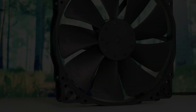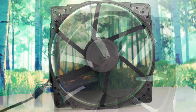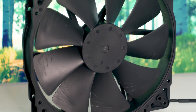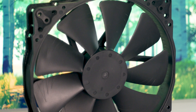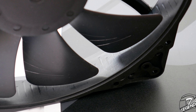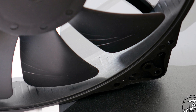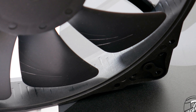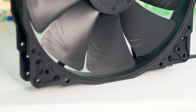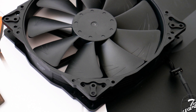So what's the point of this fan in the end? It's simple — this fan will spin slower and deliver better performance overall. That's the whole deal with larger fans. But just because this fan is not the popular kid in school doesn't mean it lacks features in terms of quality and technology. Apart from the SSO2 bearing system, the NF-A20 PWM Chromax Black Swap features inner surface microstructure — small dings found on the inner side of the fan frame. These reduce the noise generated by the tips of the impellers and improve airflow and static pressure by reducing flow separation. Other features include the well-known flow acceleration channels, placed in sets of three on each blade, which speed up the airflow within the fan frame and increase efficiency while maintaining or lowering overall noise.